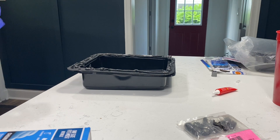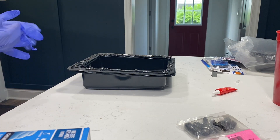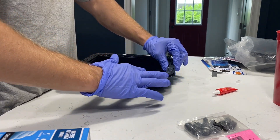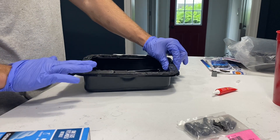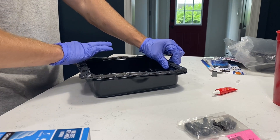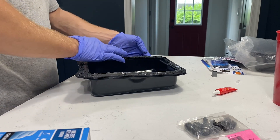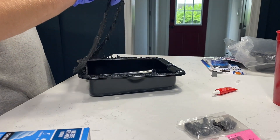Round two — putting on some gloves, spreading it out in a nice even layer, then I'll go ahead and put that gasket on. After that I'll head out to the car with the thread locker. I'm going to start by putting on a couple screws at a time, thread-locking them on. When I took it off there was no thread locker, no sealant — nothing. Those half-inch bolts had an extension on my socket and it took a quarter to half a turn to get them off.